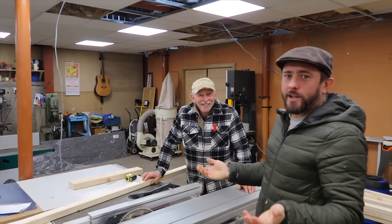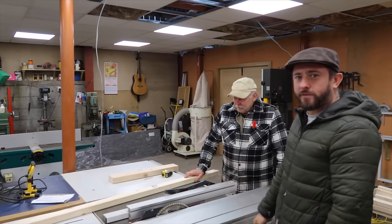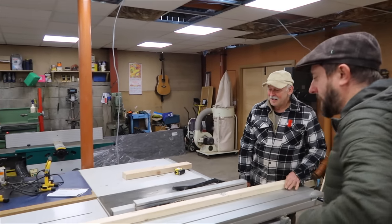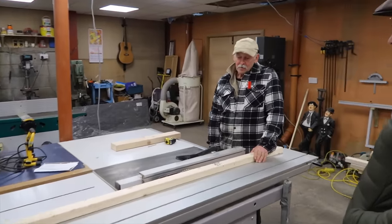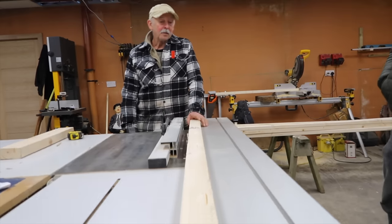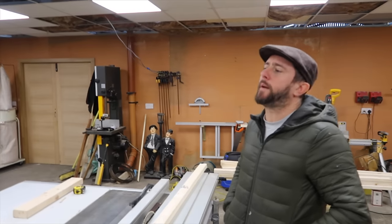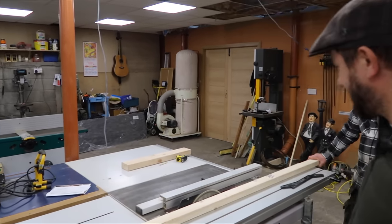All right, wearing gloves isn't going to do you any favours here, because you're going to lose your finger in a glove or not. Maybe some eye protection, maybe some ear protection. Do as we say, not as we do. What you do is bring your saw down a bit so it's just above the surface of the wood, then you've got minimum saw visible, so fingers are a little bit safer. We do dust extract as well, so I'll put that on next. Bill's done this for many, many years. He knows what he's doing, though he's never built a van before, so it could be a right mess.